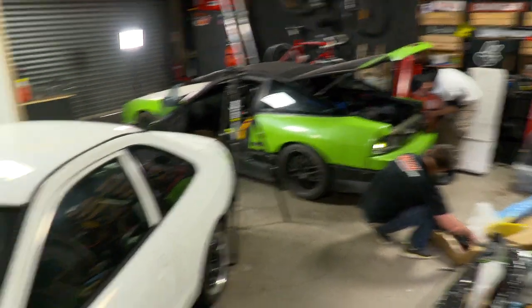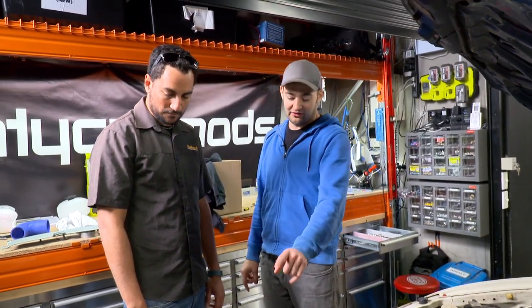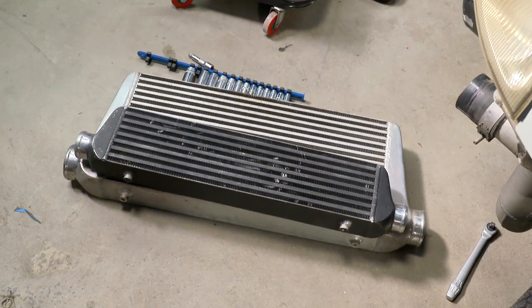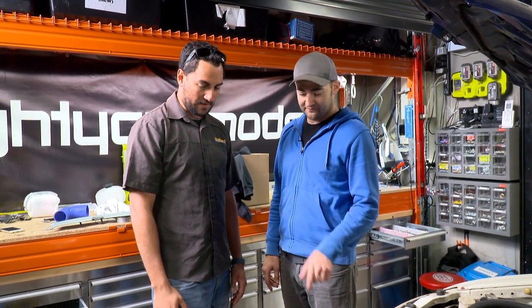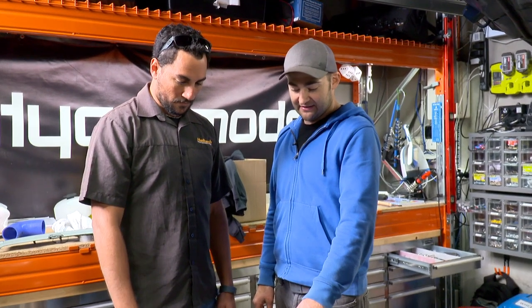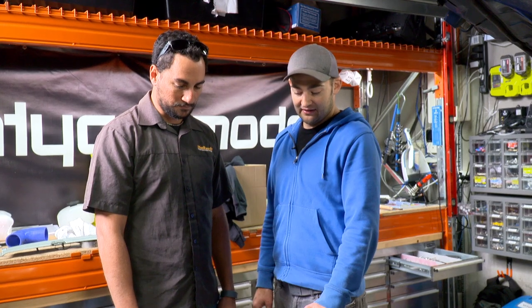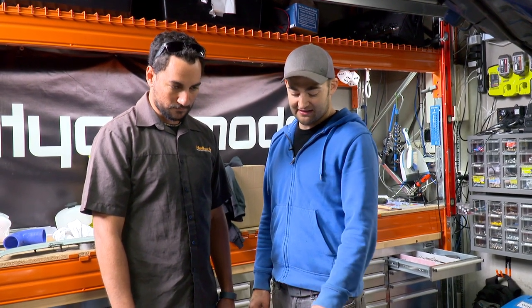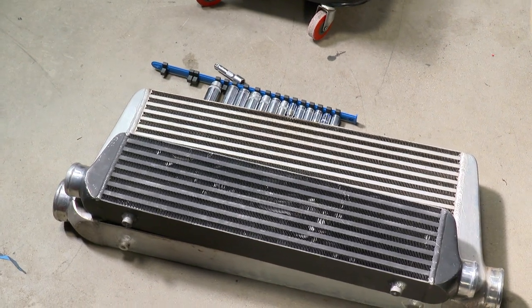While team thrashed-out 90s 180SX is fiddling with their rear end, we're getting nerdy up front. The new intercooler will flow fine — it's a similar size, just longer. The original one is not only massive but weighs about five to ten kilos. It's just oversized — bigger than what's on Supergrams, which makes 280 kilowatts and doesn't heat soak.